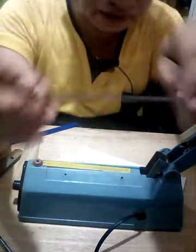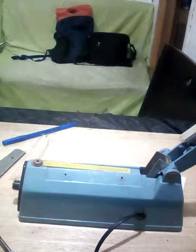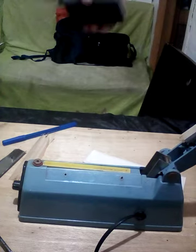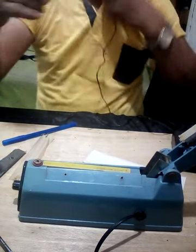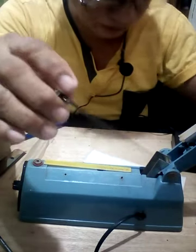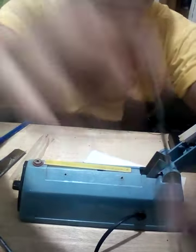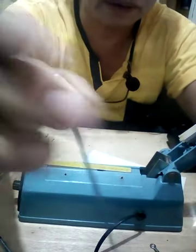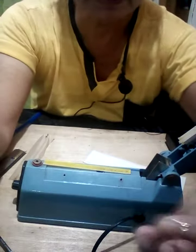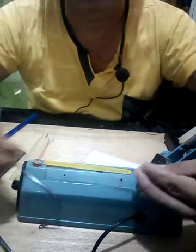This is the heating element. Here's where the heating element was removed from this sealer. Let me confirm — the one I bought is large, but that's okay because you can cut it. The difference between the new one and the old one is size — the new one is bigger and longer. You can cut it here, and then crimp the terminal ends. You can get two pieces out of one — just crimp them. So don't worry if the one you buy is longer, you can cut it.